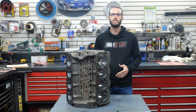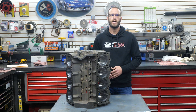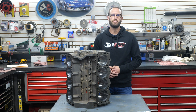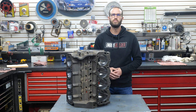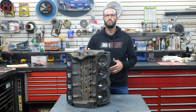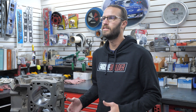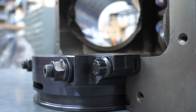The 9.5 deck block is also compatible with OEM heads. The Manowar block features Siamese cylinder bores in 3.995 or 4.120, which finish at 4 inches or 4.125, respectively. The bores are semi-finished, a smidge under to allow engine builders to final hone to suit the pistons and ring packages being used. Our block is being bored to 4.125, and it could be safely bored to 4.200. The cylinder barrels are extended into the crankcase at the bottom by a half-inch to provide superior piston support with long-stroke crankshafts.